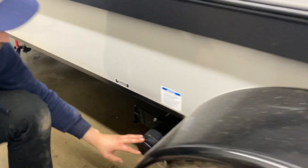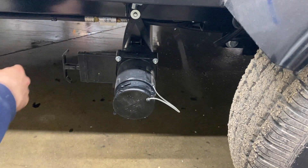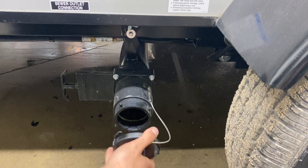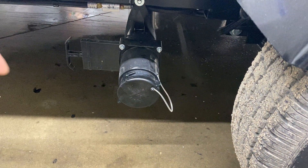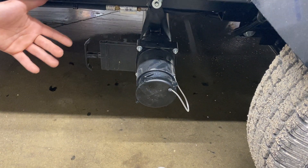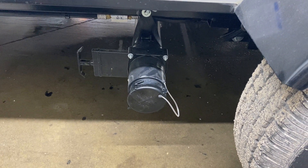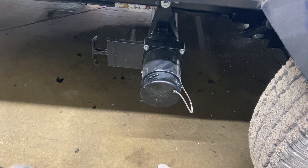On the other side of the wheel well we've got your other sewer connection — this is for your black tank, which is filled from your toilet, indicated by the black valve. Same connection: pop the cap off, the sewer hose attaches and locks into place, and you slide that valve open when dumping. Always dump the black tank first since it's your dirtiest water — let that drain completely, then dump the gray tank last, as sink and shower water is typically cleaner.